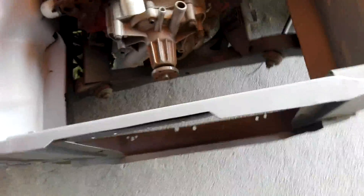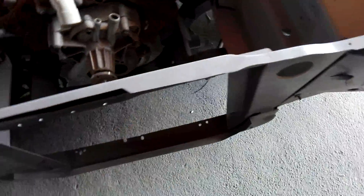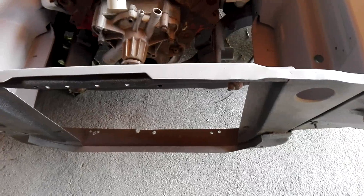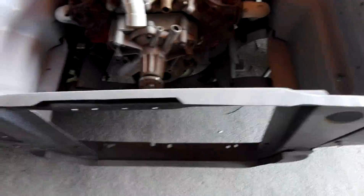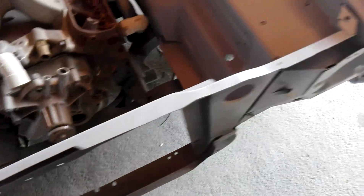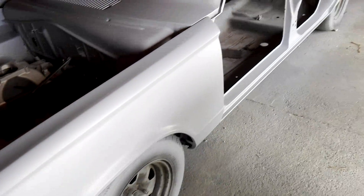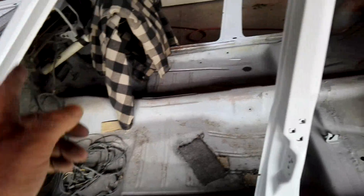Same in here, I've done all that too. I've just smeared a little thin bit of filler in there just to hide the worst of the damage, but I've straightened all that out. If you look back at some other videos, in the last one I mentioned that it was quite ripply and dented — just from factory basically and probably a little bit of damage over time. I've straightened that out and just tidied it up a bit, and I've basically primed the guards and given the door jams a good prime too.